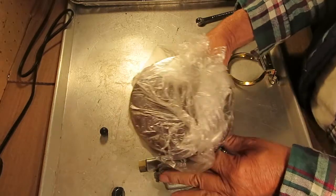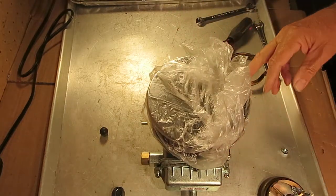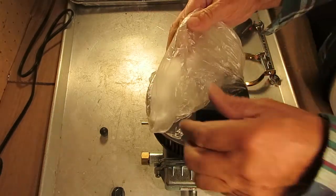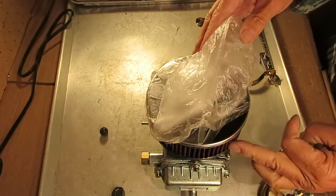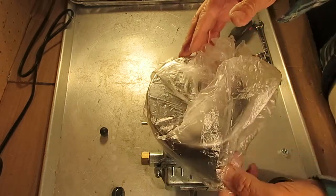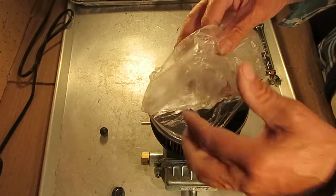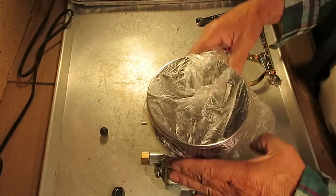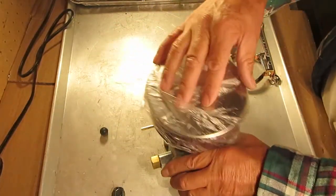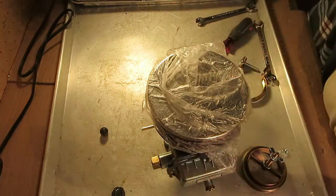These look really nice, especially if you've got something like dual carburetors or tri powers — these look pretty slick. They're chrome. These are oil-based air cleaners, so you clean them with solvent or gas, and then put some lightweight oil on it, and there you go. So that's how you use the adapter. Thank you for watching.